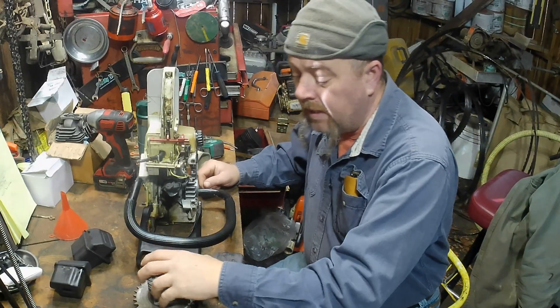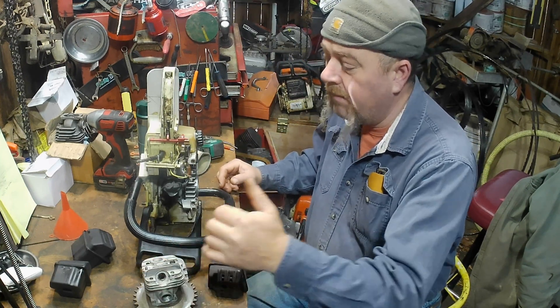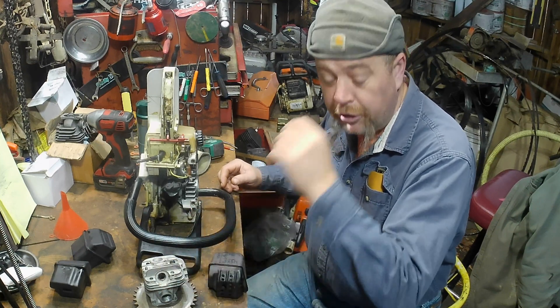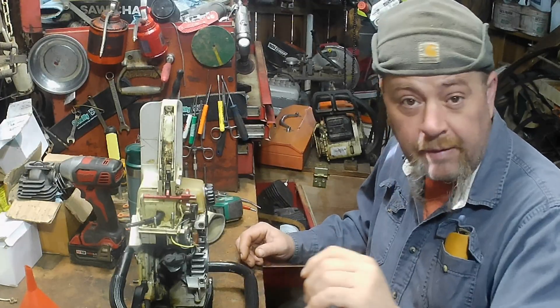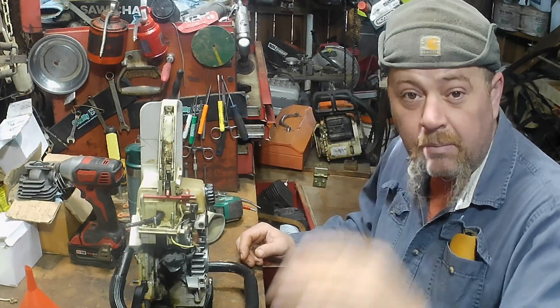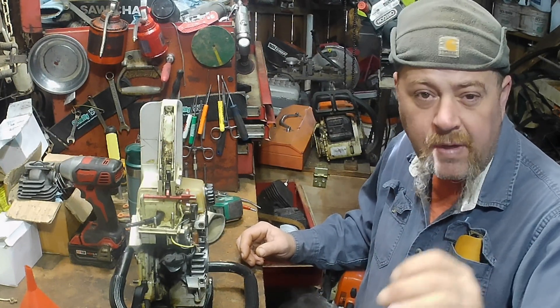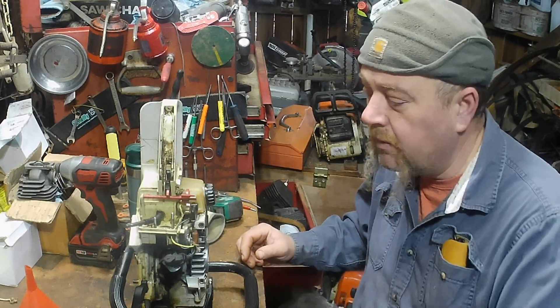After this transfer timing and reshape, next things we'll be doing is possible machine work. I may need to bring the exhaust back down — I took it higher than I should have, worried about 96 and a half degrees. Bringing everything back down will leave the blow down the same but open up the intake a little bit. My intake is only sitting at 170, so I've got that to play with. I always wanted to leave that cushion in case I needed to.